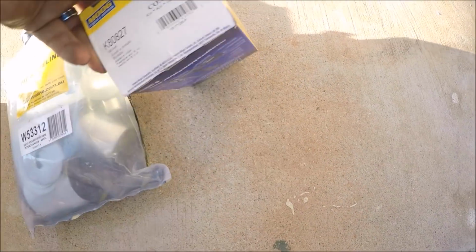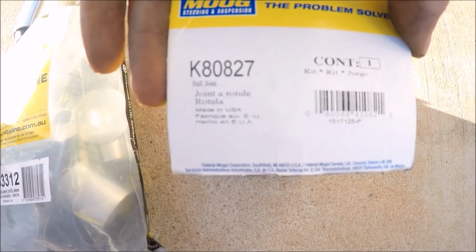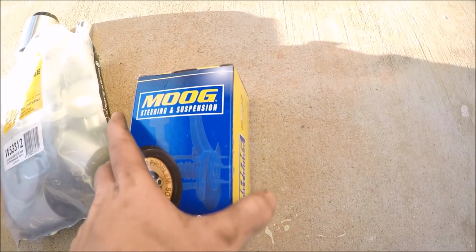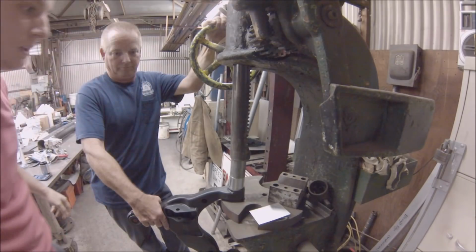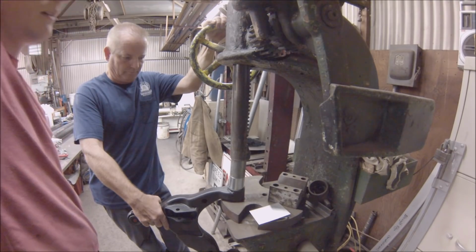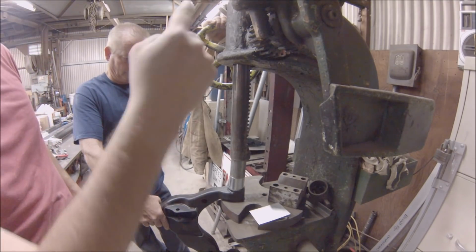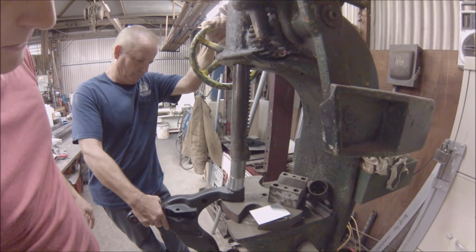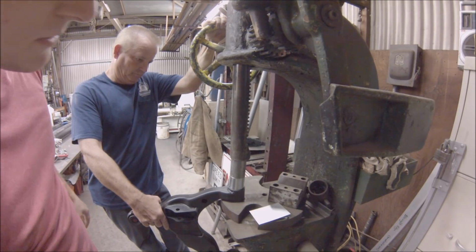And then for the lower control arm bushing, I'll attach it in the description, but this is the part number for the lower control arm bushing. It's a Moog part. Alright, so we're installing the lower control arm bushings here, and we have this giant arbor press that we're using. I've seen it done with a large vise before, but this was probably going to be easier, so that's what we decided to use.